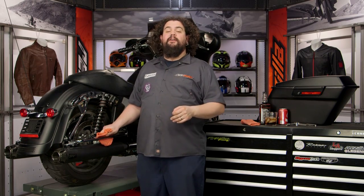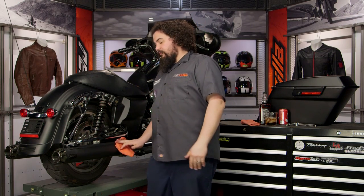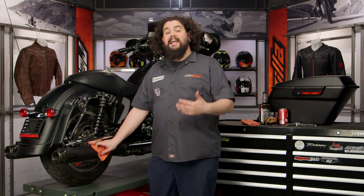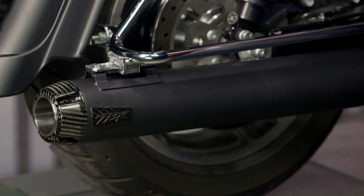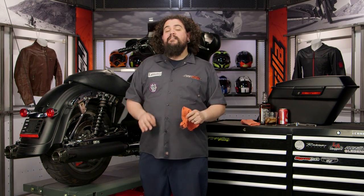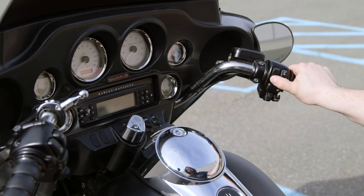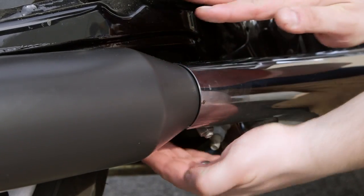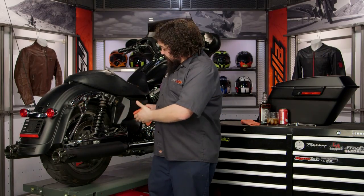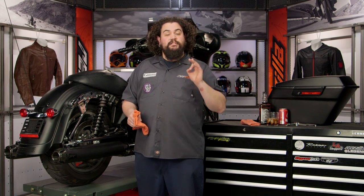If you've made it this far, I'm hoping you have not fired up your bike yet — you're not quite there. The first thing we need to do before getting this thing outside is to wipe down the mufflers. If grease is left on the pipes or mufflers anywhere, it can burn in the first time they get hot and you'll have a permanently stained muffler for the duration of its life. If you have any doubt, go back and do it again — it's not something you can recover from. Once you've got that done, fire the bike up and use your hands to check around the muffler-to-head-pipe joint for any leaks. Be very careful not to come in contact with any of the pipes — they are super hot, they heat up quickly, and you can burn yourself.